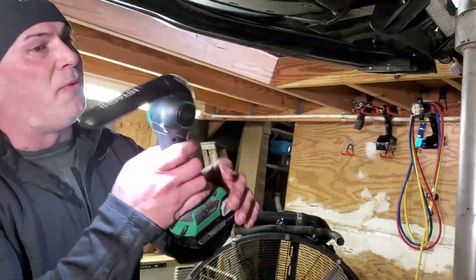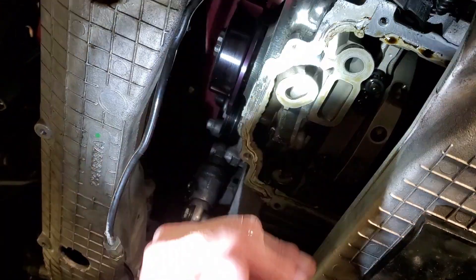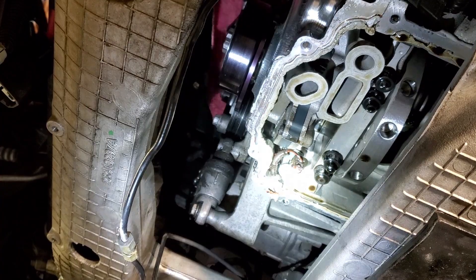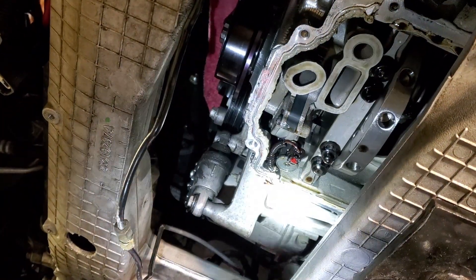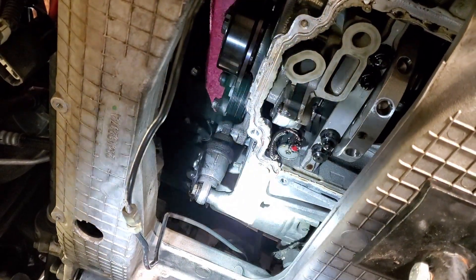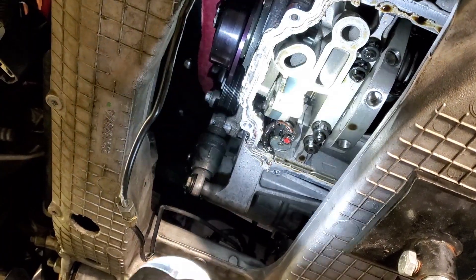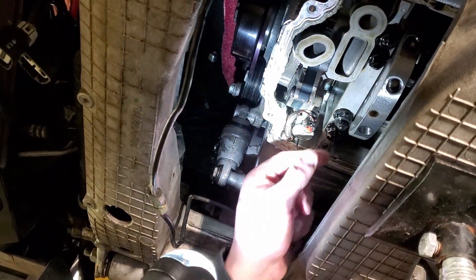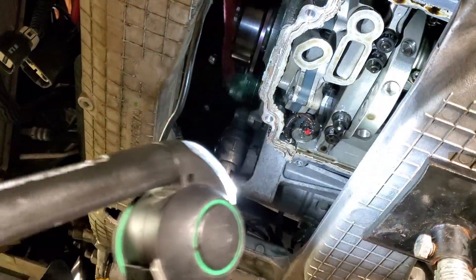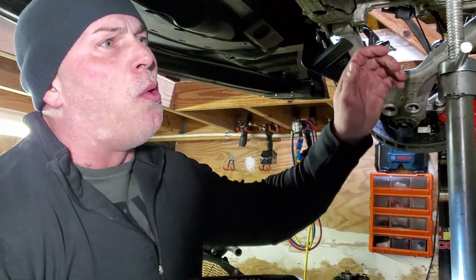One more thing before ending — I didn't have to remove the timing cover. I have an LME billet timing cover which has a VVT delete built in; it's a super light, very nice piece. It comes with an O-ring but I still use GM sealant on it — I don't trust the O-ring personally. Looking up in there: oil pump looks fine, timing chain shows no discoloration, all lines are connected. The motor appears perfectly healthy.